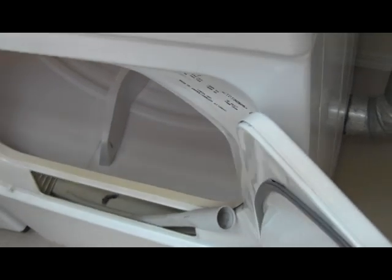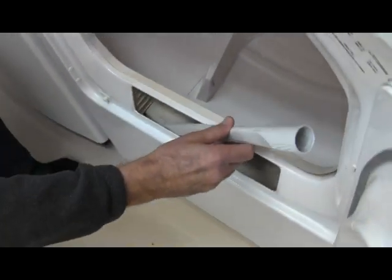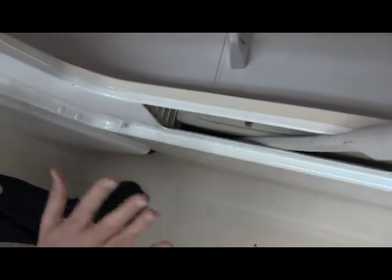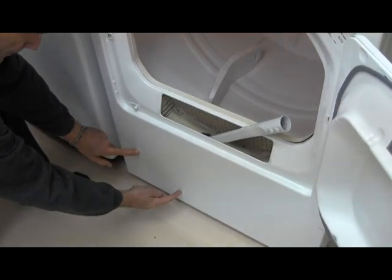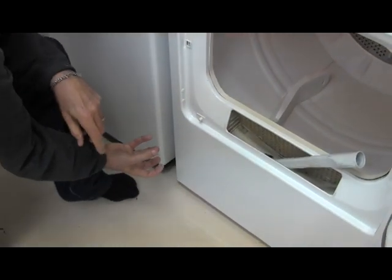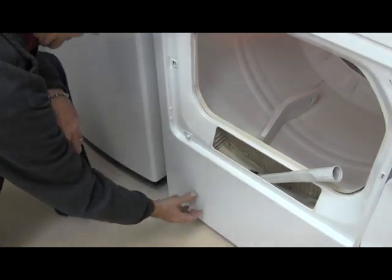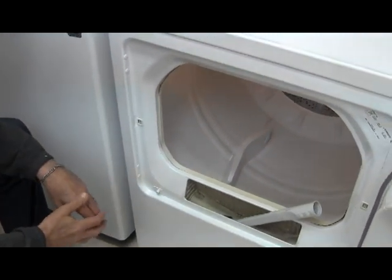With this particular dryer, because I've taken it apart before, I know that the fan is down here. So I'm making sure that when I'm vacuuming — with the power off — I'm vacuuming down where this fan is. What I found when I first took this dryer apart is there's a V-shaped chute that went down to the opening where the fan was, and it turned 90 degrees. Right where it turned, there was a hard chunk of lint. I'm guessing that because lint comes from the dryer damp and wet, if it hit the edge of the metal it could fuse itself to the metal. I had this rock-hard chunk of lint there that didn't look good to me.